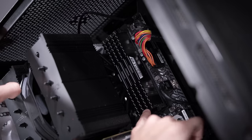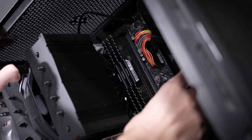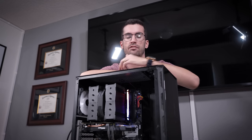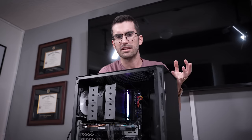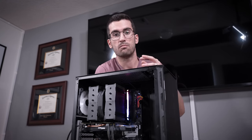We've already cleared the CMOS, so it's not a software setting — it's not like a frequency setting in the BIOS for memory. So let's try swapping out some DIMMs. Yes, all four of these DIMMs are seated correctly, and to the best of my knowledge none of these were touched between the time the system was working and when it stopped. I've tried all four slots with a known working DIMM — still black screen and the board immediately throws up the DRAM LED.